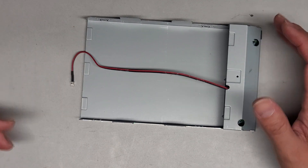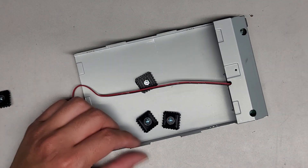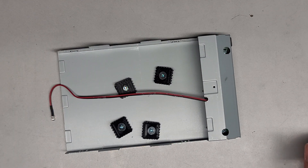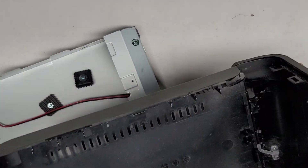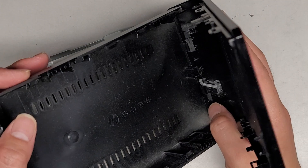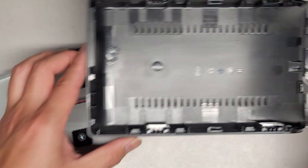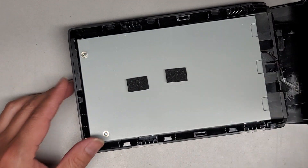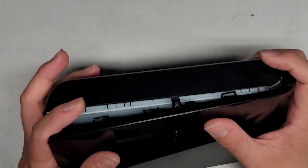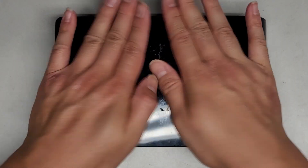The customer decided to just leave it outside because they're probably going to send it to data recovery. But basically you would slide the hard drive back in, get the LED cable taped back in, and obviously get these four screws back into place. Then you take the plastic box and drop this back in. I broke off that clip — so here you can see it's actually not a hinge, it's a weird clip. But you would do that and then this would go upside down into there and just close into place — line everything up and that's pretty much it.